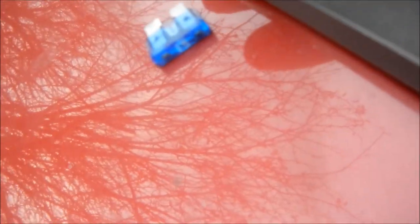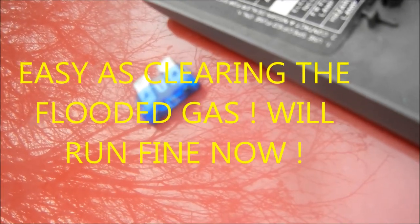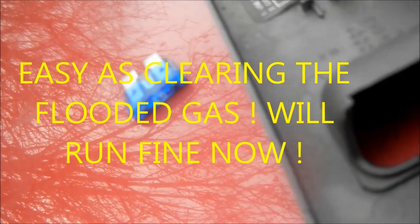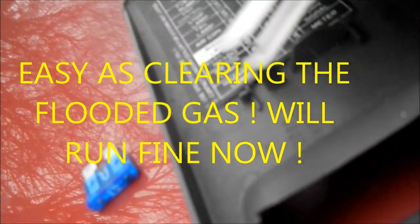What I'm going to do is spray starter fluid inside this air box here. I've got the fuel pump disconnected — it's a 15-amp fuse, third one down from the top. I had that little fuse puller that came in handy. I'm going to give that a try and see what happens.